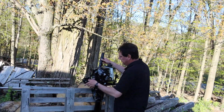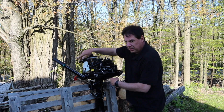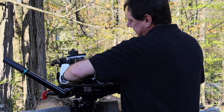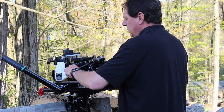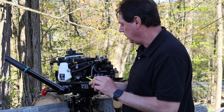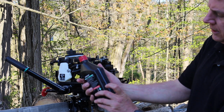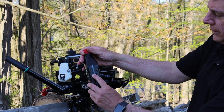and there's a drain plug. It's a yellow, this yellow plug right here, and it has an integrated dipstick built inside, so you'll know how much oil is on there, just like you do with your car. You'll be able to see low, high, full, and we've got to add 12 fluid ounces. So they gave us 15 fluid ounces, which is the entire amount, and we want to do 12. So we want to fill it until we get to there.